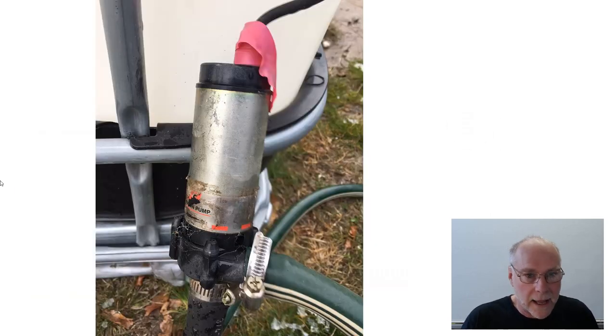I'll start off by looking at this pump. It's a Johnson pump, a 12-volt Johnson pump. I actually took this photo just a few minutes ago — I'm using it now to pump water out of a big reservoir onto plants and trees that I need to water. In that application, where you've got a free-flow input and a free-flow output, the pump actually works really, really well. But it's not like that in a water-air intercooler system, because you are circulating water through restrictions.